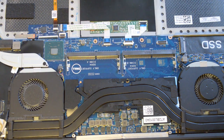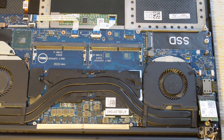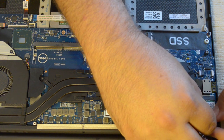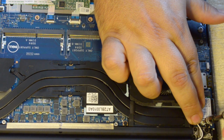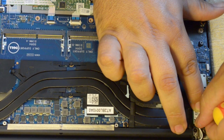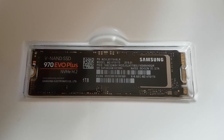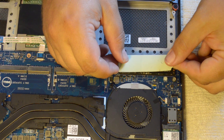Next, I replaced the Wi-Fi card. I replaced the Killer 1535 card that came with the laptop with an Intel AC9260 card — I'll have a link in the description. Remember, if you don't have an ethernet connection, you should download the drivers for this card before you begin this process. Remember to match the antenna connectors to the right color. Once you get it into place and attach the antenna connectors, you can use the single screw and cover plate to hold it in place. Next, I installed the 1TB Samsung 970 SSD. A single screw held it in place — don't forget to replace the thermal pad on top of the SSD.